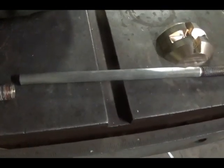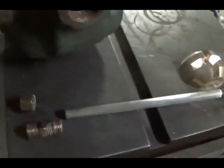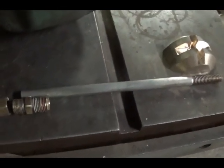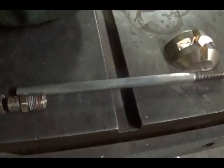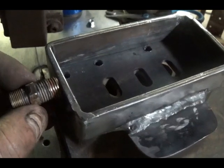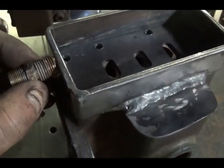All right, I found what we needed. It's actually one going up for the gladhands right here. We'll grab that out of there and take it to the shop. What I did here is drilled that three-eighths, ran a reamer through it, and we've got our compression nut there. What we'll do is drill and tap and run this in there, run this over the linkage, and then put an o-ring or some type of packing - rope seal packing - and tighten it down so it'll flare out enough. I'll drill and tap it and put it in there now, keeping it close to the top.